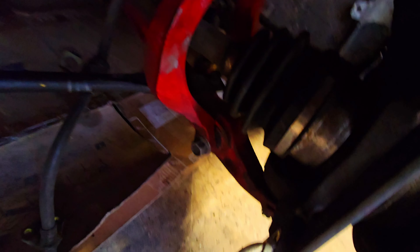EK Civic brake calipers, quarter inch spacers, stainless steel brake lines. All I've got to do now is do the other side, bleed the brakes, and test her out. I wanted to show you that you can put the Civic brakes on with the factory dust shield still on, unmodified. It's a really tight fit but it is doable. My suggestion: when you put the rotor on, do not bolt it down with the screws to the spindle — leave it loose so you can maneuver it to get the caliper mount over the rotor and thread the bolts down. Everything is the same from there.